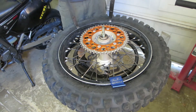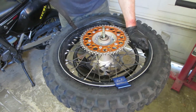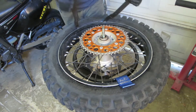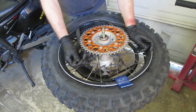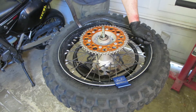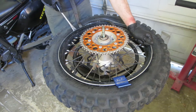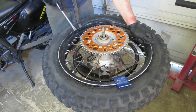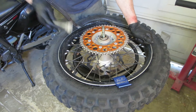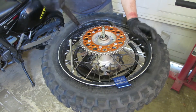Scoot it over just a little bit more and I can feel it go. Once you get that much tire over the rim, it tends to stay. I tried putting Windex on before taking the tire off — you don't really want to do that unless you want to reuse the tire, because it has a tendency to just flop back in. That work you just did tends to flop right back in. So no Windex or anything on this step.